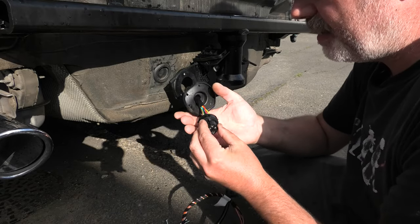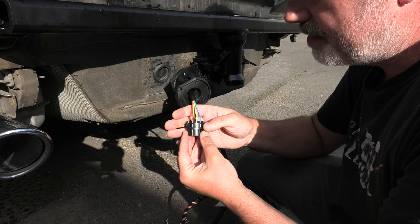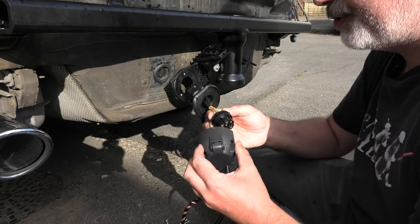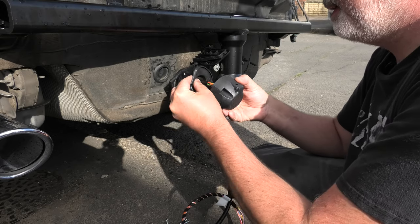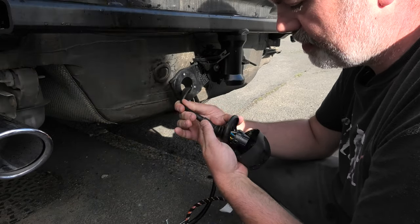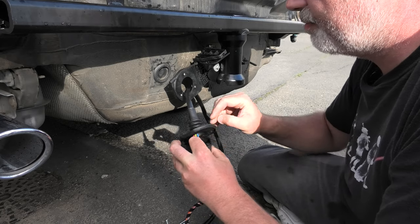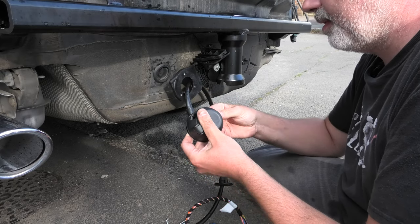If you find that the whole connector falls apart in your hand and you end up with a bag of pins in a complete panic — like I just did — what you need to do is make sure the yellow pin is at the top, then going clockwise: yellow, red, brown, green, white, blue. Then you can push the connector back together. Pull the rubber boot closer to the connector, put the yellow wire at the top between the two screws, then turn and wrap the rubber seal around the whole connector.